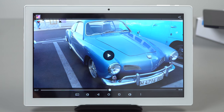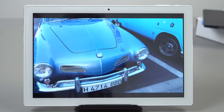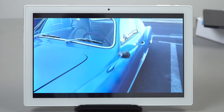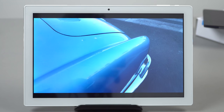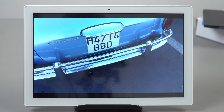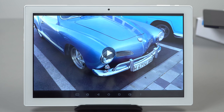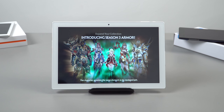For video playback, playing a 4K H.264 file runs at about 20 frames per second instead of 30, so you'll want to stick to 1080p maximum. The tablet also doesn't appear to support the HEVC codec in the native gallery player — you need something like MX Player, but even then the frame rate is choppy. Best to use 1080p files with older codecs.